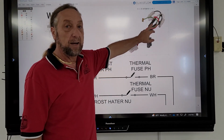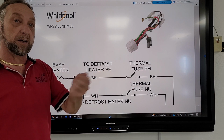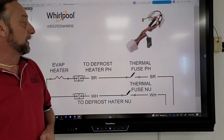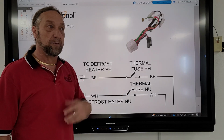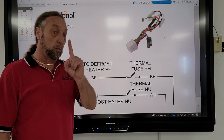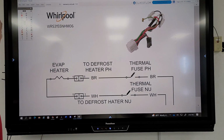They look almost like the Whirlpool ice makers that have the thermal fuse connected to the mold on the power supply coming in. So I just wanted to bring it up that you need to start paying attention that we have now two thermal fuses, and one of them could be bad and you won't have a defrost system. Now if we look over here,